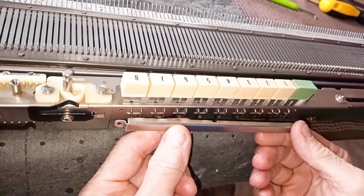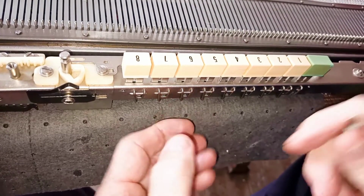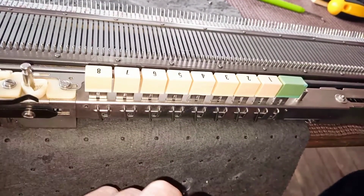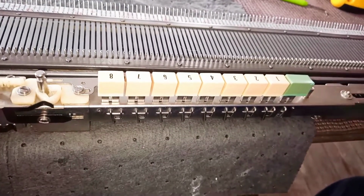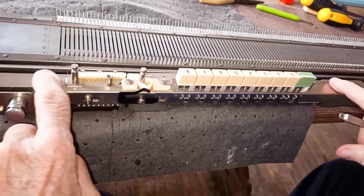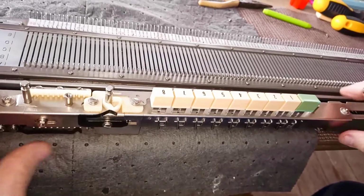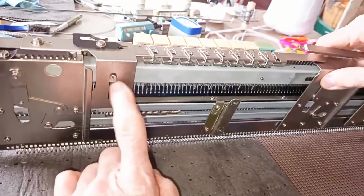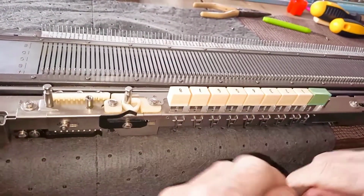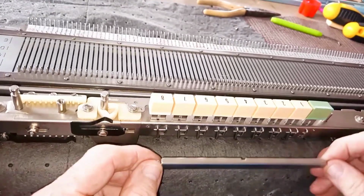Once you take this retaining rail off, we just showed you that all of these pins will fall out if you were to rotate the machine up from the front. The only thing holding them in right now is gravity for the lock pins and the spring load of the button. So if you take the whole button rail out, which is this piece and the button rail, we showed you in the previous film how you loosen these screws and slide them out of the way. You take this clip off, and the whole button rail will come out. You have to wiggle it around this retention screw here, but you've got room to do that once you have these ends so that you can move the whole rail over. Once it comes out, then you take this off, and all of the pins and the buttons will just fall apart. Yeah, disassembly is really not difficult. Yes. Preventing disassembly is the issue.